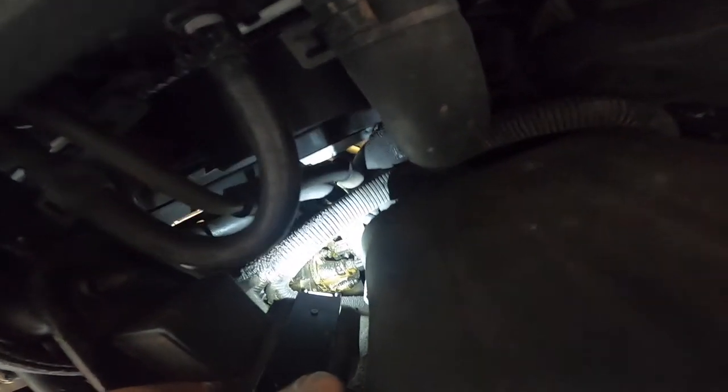What's happened is oil is leaking from somewhere — it got onto the starter and shorted out that motor without making good contact in there. I'm going to go ahead and lower the car down, find that oil leak, call the customer, and let him know that the oil leak is causing his starter not to work correctly. If we fix that starter and not the oil leak, it'll start for a while but then it's going to crap out again on him.